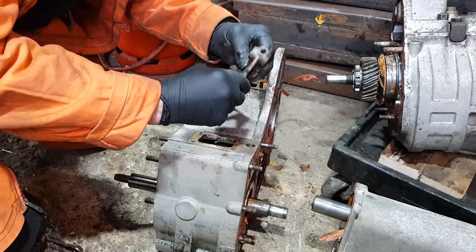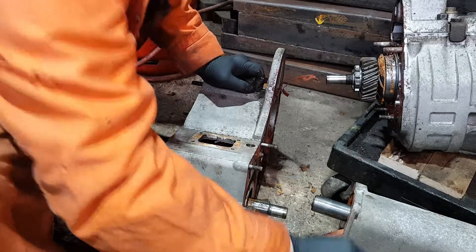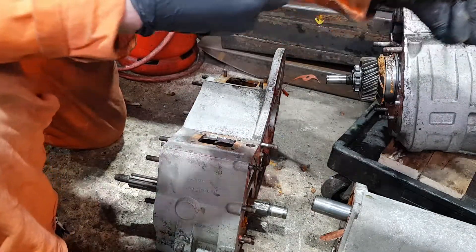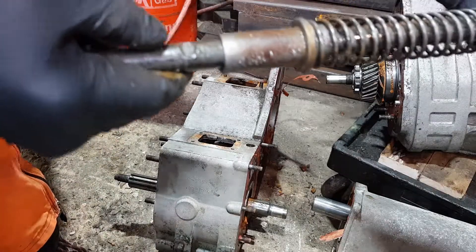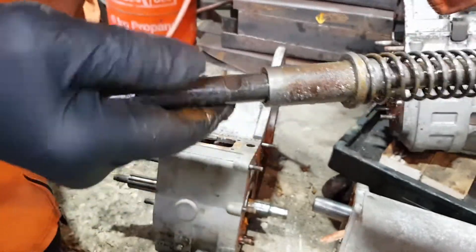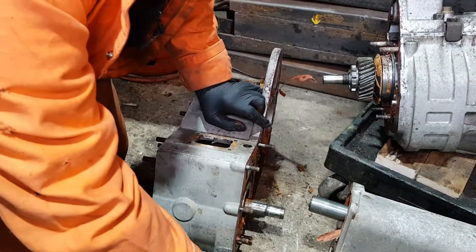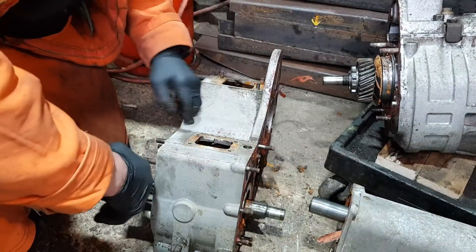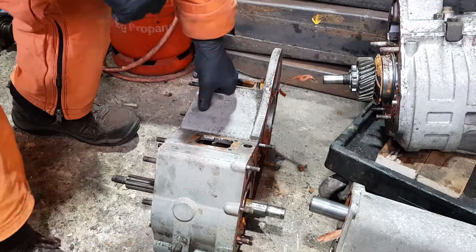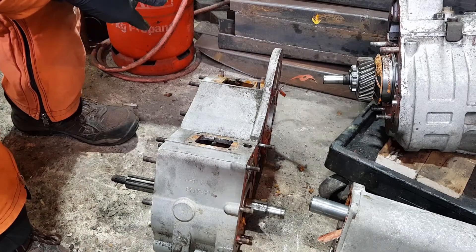There's the fork — it sits on that rod. See there — there's the groove that that bolt sits across. So there's no point just loosening the bolt; it's really got to come out in order for that rod to slide out. So that's it — that's your three main parts. We'll get that out of the way, then we'll take the bell housing off and open up the gearbox.